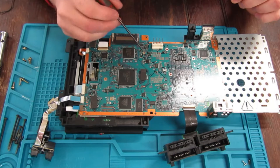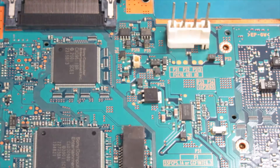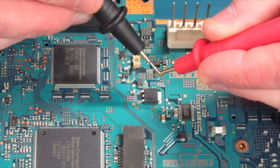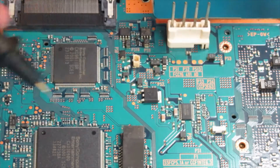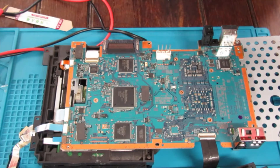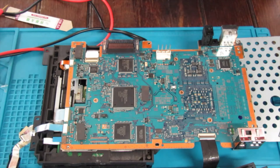On this board — sorry, the board is upside down to me — the PS5 screw position is the fan fuse. I've zoomed in as far as my camera will allow. The PS5 fuse here is for the fan — as you can see, no continuity. If we go over to PS8, and PS7 here, that also seems to be broken. I'm using a diagram to find out which fuses these are, because there are different revisions of these boards. I'll link the website in the description — it has all different revisions with fuse locations, so check it out if you're having a similar issue.